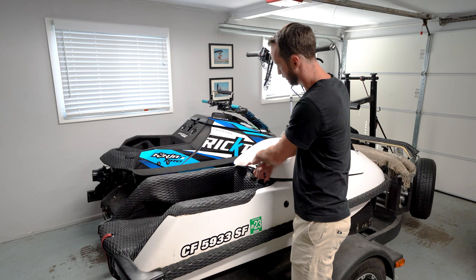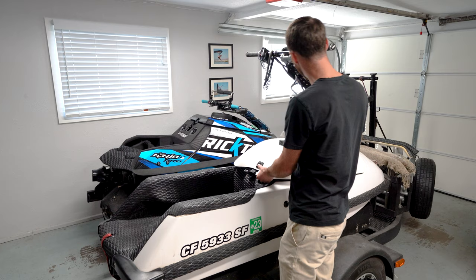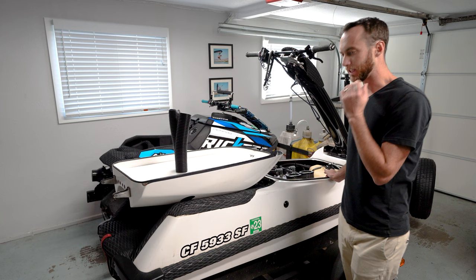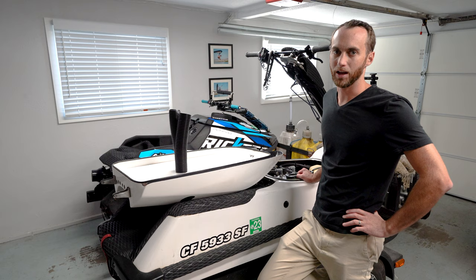If you leave this hood on overnight and you come back the next morning and pop this hood off, there is going to be tons of condensation all over the top of the hood. Your whole engine's gonna be covered in water drops. And keeping all that moisture sealed in, it's gonna corrode everything out. It's not gonna last long. It's most certainly not going to look pretty for very long. If you have a really nice looking engine compartment, it will not look nice like that for long.